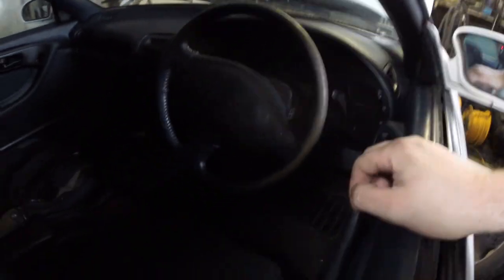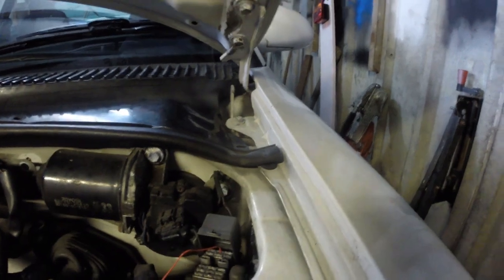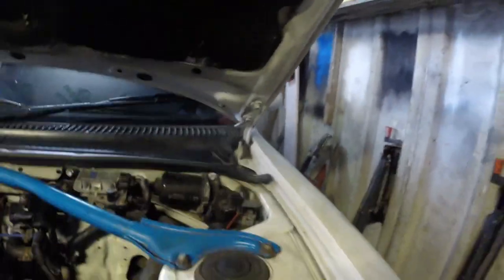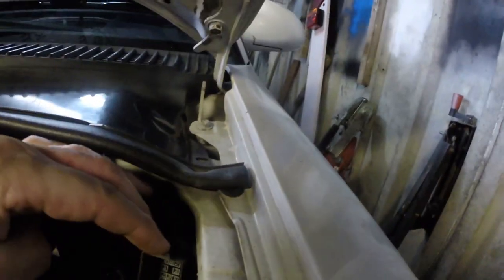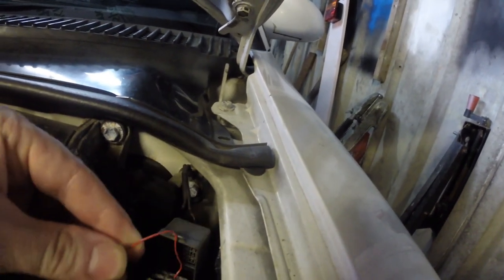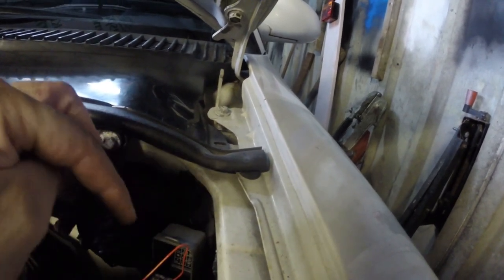So, following the manual, the first thing we do is turn the ignition on. So next we go to the diagnostic connector, and we short terminals TC and E1, which is that one. Now I've got a new special service tool. There we go. Basically a bent paper clip. So we short them two terminals, and then after we've done that, we just keep pressing the brake pedal, which is probably not a good idea with the caliper off.